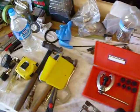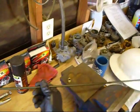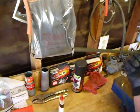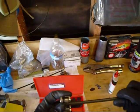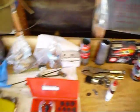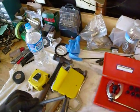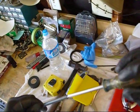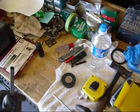What you want to do is take this little pipe cutter and take your pipe that you want to flare. This is, I believe, 5/16 steel pipe — like fuel line tubing. You put this on there and tighten it up and spin it around. Everybody knows how the little pipe tubing cutter works. And then once you do that, you want to take a deburring tool and deburr the end of it like that. Get all the burrs out.